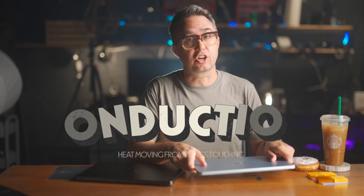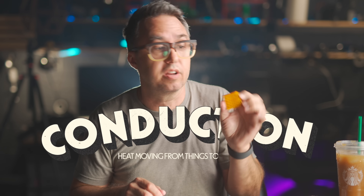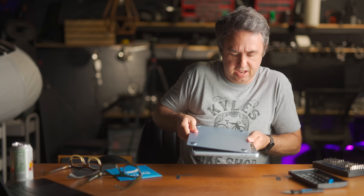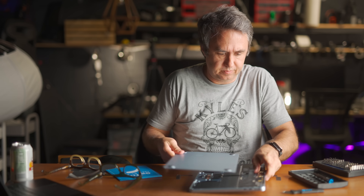I'm going to explain my plan, why it works, and do a baseline. The MacBook Air's case is made out of aluminum. It just so happens that aluminum is super good at moving heat from one thing to another if something's touching it — this is called conduction. This is why when you see little heat sinks on electronics, they're usually made out of aluminum or copper. Copper is even better than aluminum, but it's heavy. I'm going to use the aluminum from the case to move the heat from the CPU inside to the bottom case and out into the air. Right now, if you open this up, there's an air gap between the CPU inside and the bottom of this case — they're not touching.